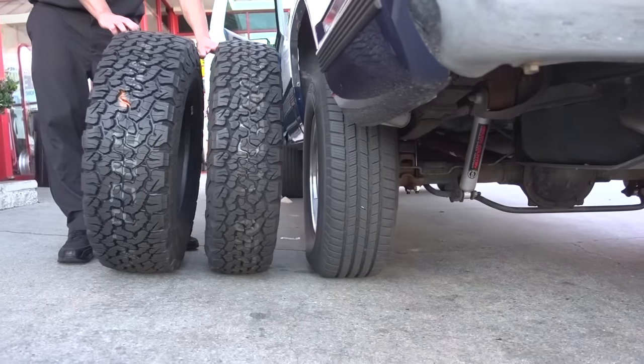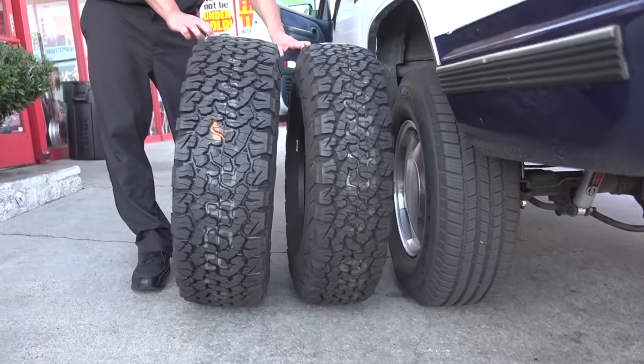The 235-85 is basically a 32-inch tall tire and about 9.3 inches wide. I'm going to be putting them on my factory rim, because I want this to look factory. I want to build this into an overlanding rig — I want it to actually work, be usable and pretty decent off-road. I'm not going to be rock crawling, just going through overlanding trails. Both aesthetics and performance led me to the BFGoodrich KO2s and this slightly skinnier tire size.